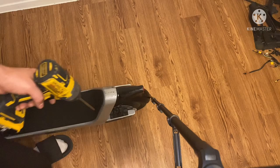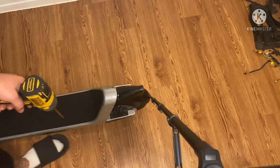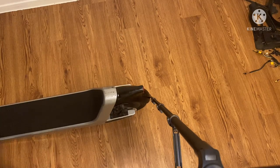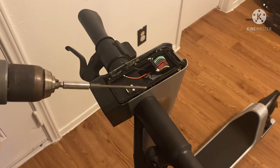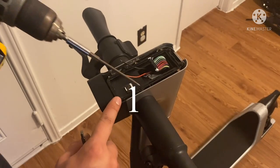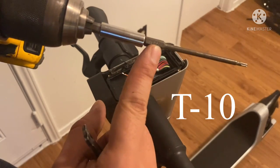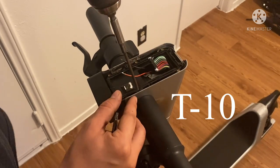To remove this bolt, you will need a 5/8 or a 16 millimeter socket with an extension. Use an impact gun to break this loose — a hand wrench works too. Make sure you put the brake in correctly — it goes into that little hole. Pull that out and the whole fork should lift up. We have the front wheel off with the fork. Now we're going to loosen up the back brake. Be sure to put your screws back in place so you won't lose anything. Now let's unscrew these screws — there are one, two, three, four — and you will need a T10 to remove those.